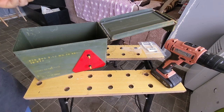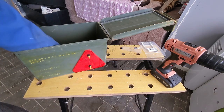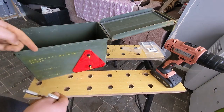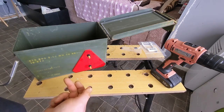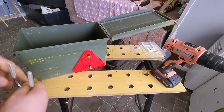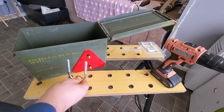You know what, I've just realised there's another very good reason why I should do it that way up, because then these nuts that I'm going to be trying to tighten up are much easier to get to when I'm going down into the box. Otherwise I'm going to have to try and get between the rear mud guard and the rear light, whereas this way I can just get my socket straight on. So actually that decides it, it's going that way up.